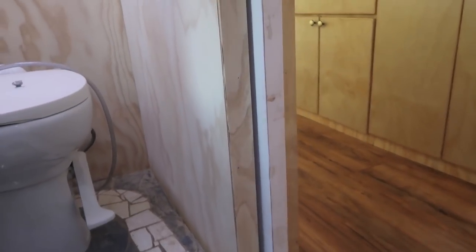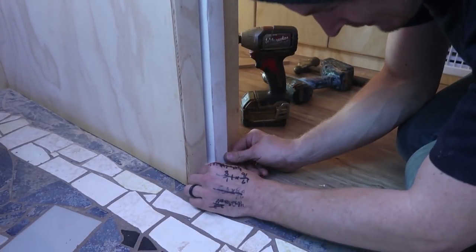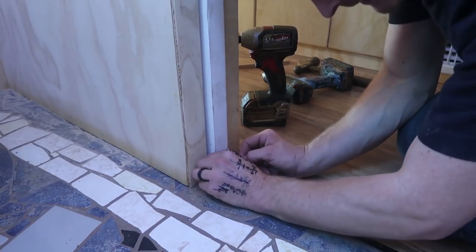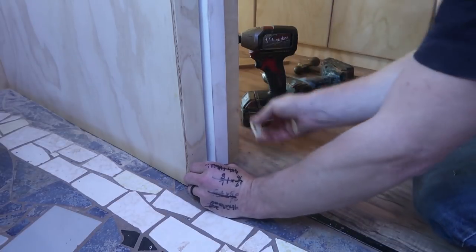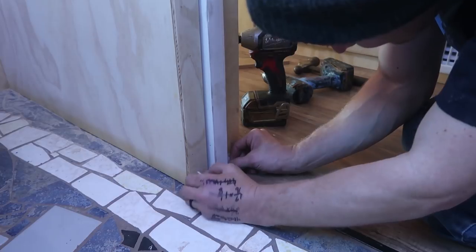Now when I close the door it's really tight — if I hadn't screwed up the lamination job it would be pretty much impervious, but this is going to be acceptable. When I slide the door back and forth it's still dragging across the wall because we're on a slope, but I don't want the surface dragging. There's one more piece of hardware — these are basically door guides. They go in just about like that, so if the door leans one way or the other, these absorb the movement and the door doesn't rub on the surface.